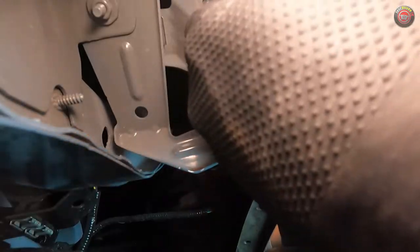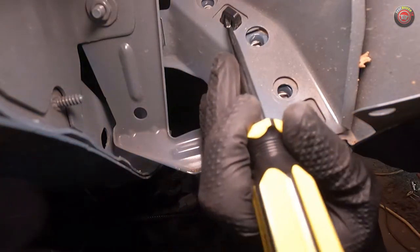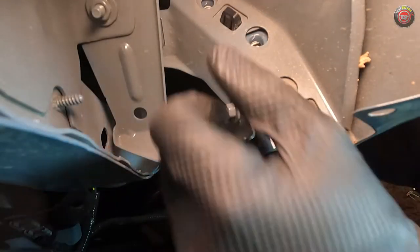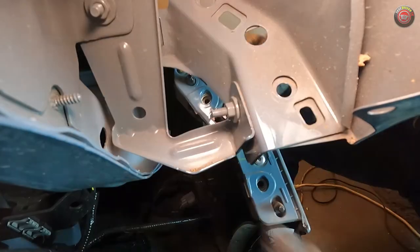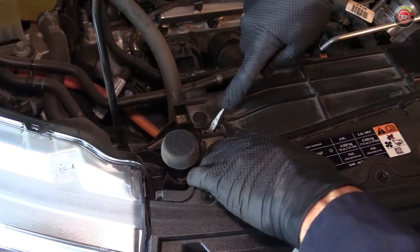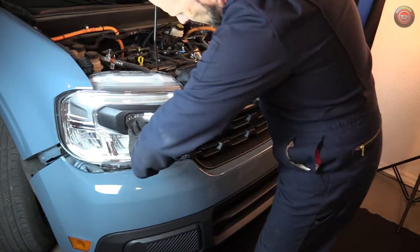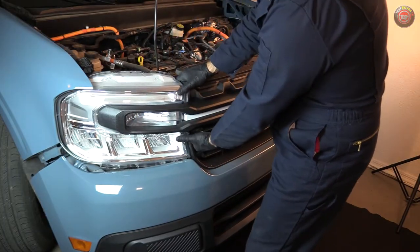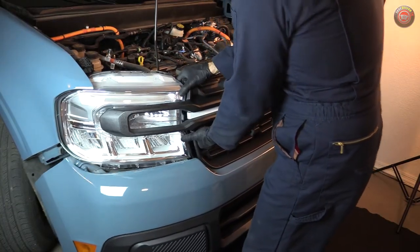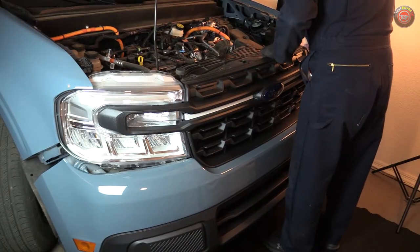The last items to detach are the plastic alignment clips on each side which hold the bumper in place. They have two small tabs which you can carefully press in with a screwdriver, squeeze with pliers, or even with your fingers to release — just be careful not to push too hard with a screwdriver as they can break. Once all of this is loose, you can begin gently pulling the top tabs of the grille support bracket away. There are two tabs holding it in place that a screwdriver can help with. Once these are both free, you can begin working the entire assembly loose. The key areas of care are the grille wings which are attached to the headlights with small clips — they will pop loose with a bit of gentle hand work. Don't pry them with a screwdriver; you can scratch or crack your lenses. I found success lifting up under the ends of the grille close to the wings — it will come loose.